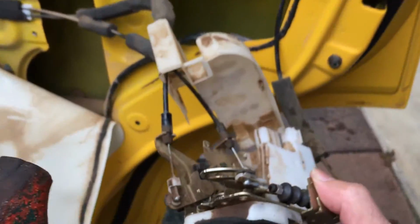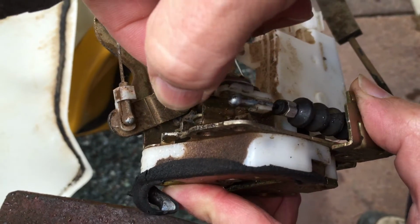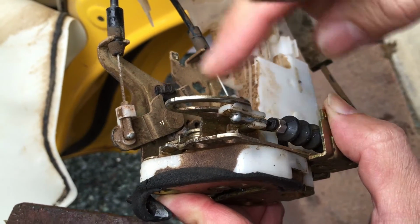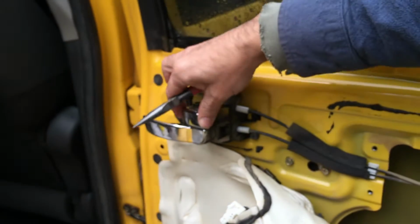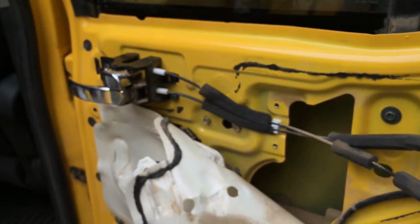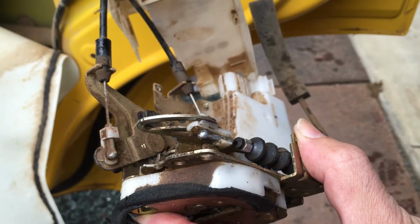You see, when I operate the handle, it retracts fully because I've given it a better return spring. And now, our locks work just fine. Now it's in the locked position. Let's say the door's closed, we go to open it. Nope, we're locked. But we can reach over here and unlock it because the mechanism's retracting.